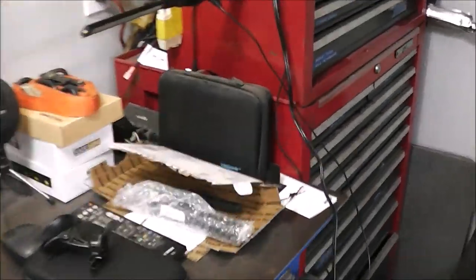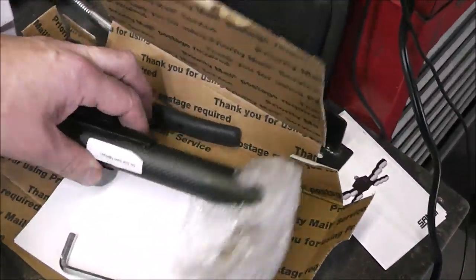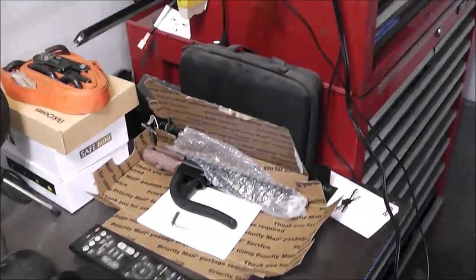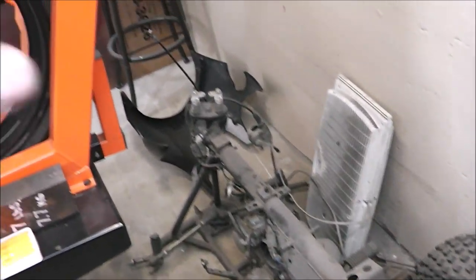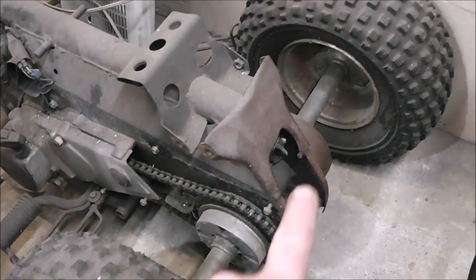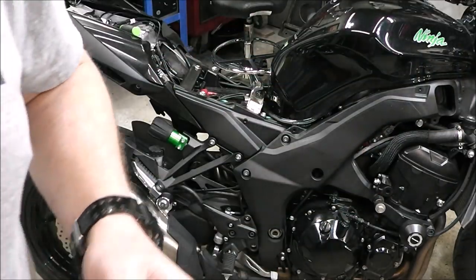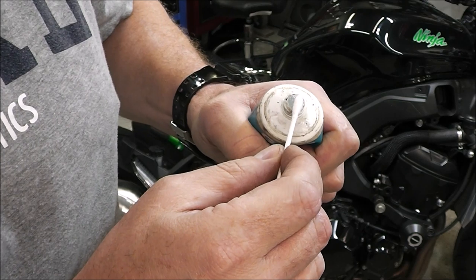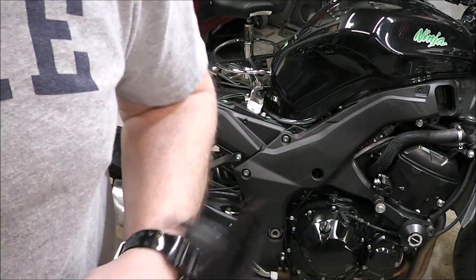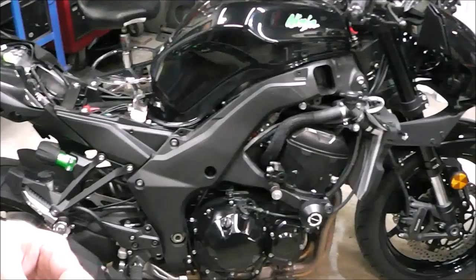I'm going to show you a little sneak peek of something coming up next week. Check this out — I've got a carbon fiber stinger, that's real carbon fiber. We'll look at that next week and try it out. We'll also have a stick welding video next week, and after that we've got to get back onto this — the 33-year-old TRX 70 build — where we're going to fabricate some parts and make a fabricated grab handle. Also, a tip for you guys with bikes: if you take a little bit of silicone compound — not the kind for caulking windows — but silicone compound made for electrical connections and rubber, put that on your grommets when you pop back in trim pieces and everything will come apart and go back together so much better. That way you don't have to worry about breaking off tabs on your fairings.